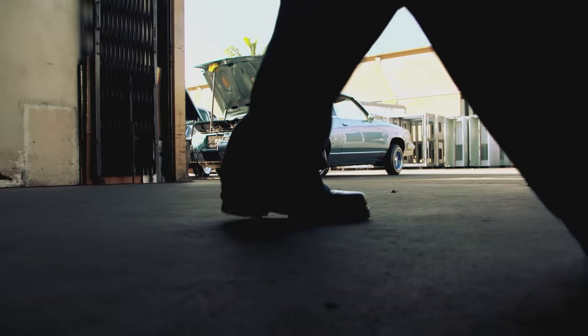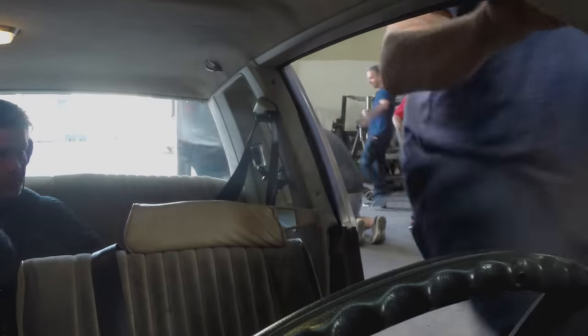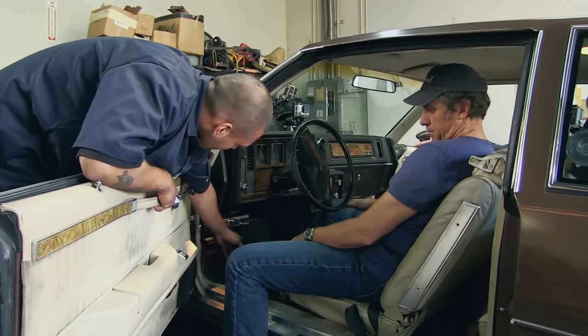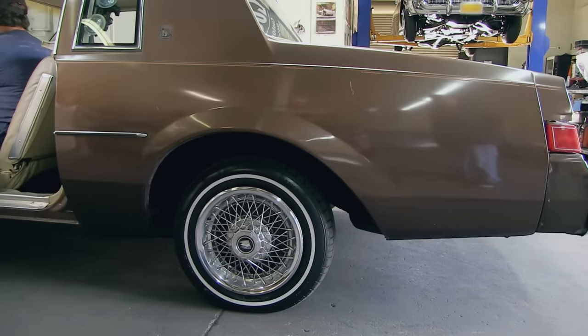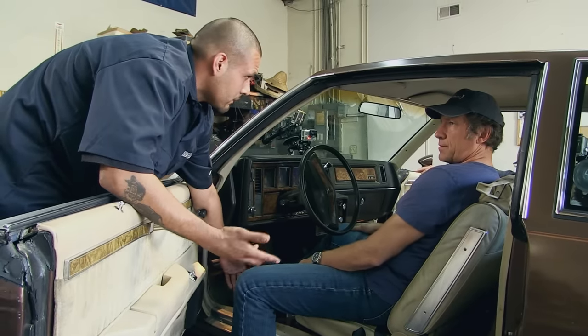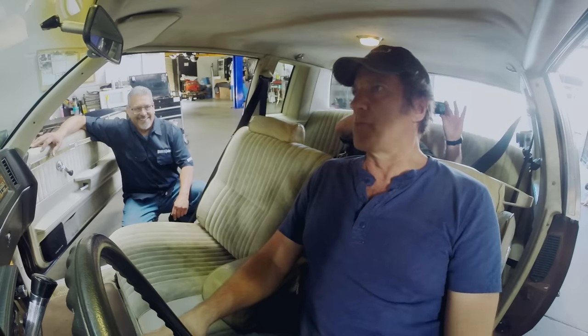I think I have a grasp on the mechanics, but if I ever hope to be enshrined myself, I'll need to learn how to make these cars hop. Your basic switches, you got front, back, left corner, right corner. When you hit the car, you always want to go down before you go up, because you don't know where the car's sitting at. You go up, it's already up, you're going to break something. We don't want to break something, we don't want to spend more money. So tap it down before we go up.